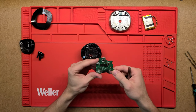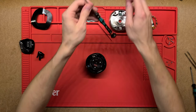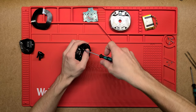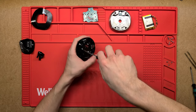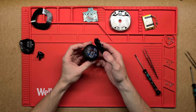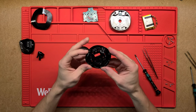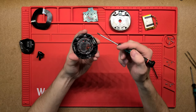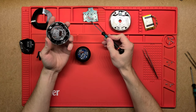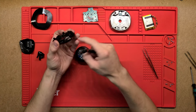Alright, a few more screws — we're back to bigger ones again, so Phillips 0. These are tight. Alright, nice. So again, just the little plastic parts with a bunch of little bits on it. That's going to be a little channel for the LED. So the power button sits on this side here, and then it's going to be the LED on the opposite side that shoots light into there through the translucent part, and then out to the front just to show the little status of it.